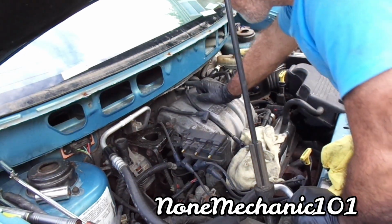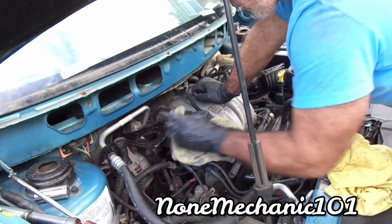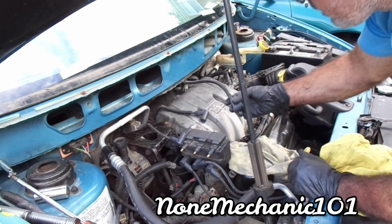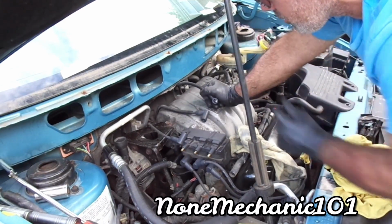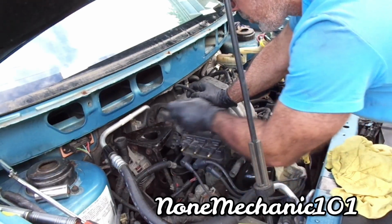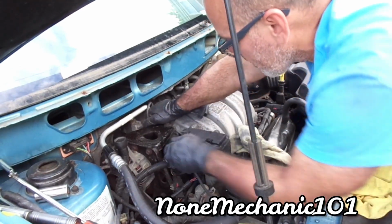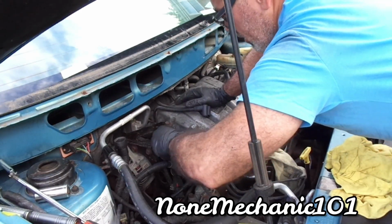Before I put the bracket back, I'm gonna plug the spark plug wires from the top and turn on the car, because I don't want to be taking off the bracket again. So just remember, number one goes, oh, it doesn't reach, so I'm gonna have to put it under. Then we'll put them correctly. We just want to see if we have any misfire.